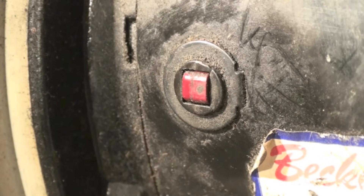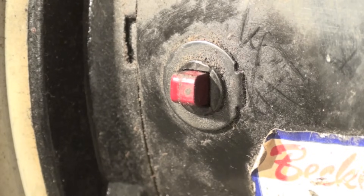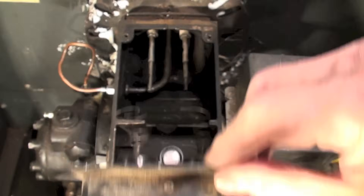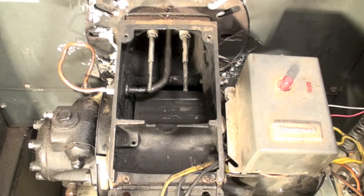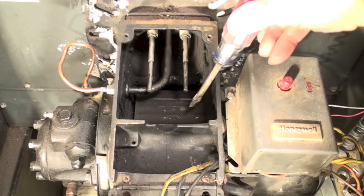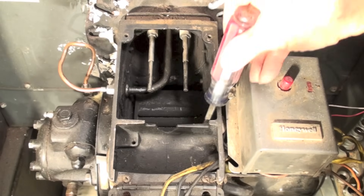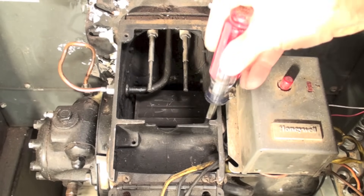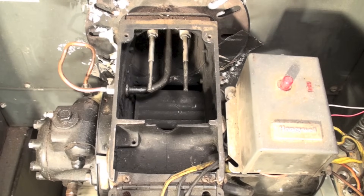You can hear the motor try to start and then the button pops out — so we've got something locked up in there. I'm going to remove a couple of screws up here and open it up. You can see the blower in here. Now it doesn't turn completely free, but it's not supposed to because it's hooked up to the pump and the pump does create some drag, but it should move fairly easily. If it moves fairly easily and still won't start, you've got a motor problem. Try hitting the side of the motor lightly with a hammer — sometimes that will get it started, but that does not mean you've found a magical fix. It means you need a new motor.